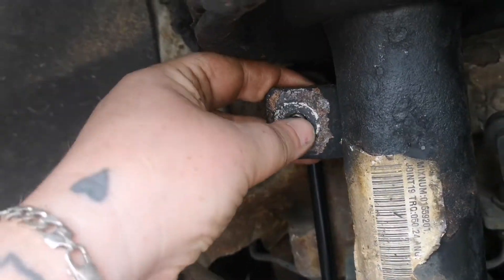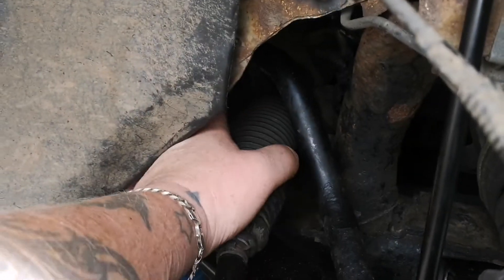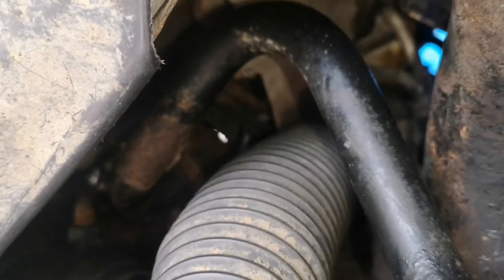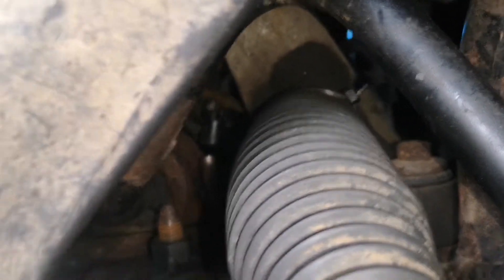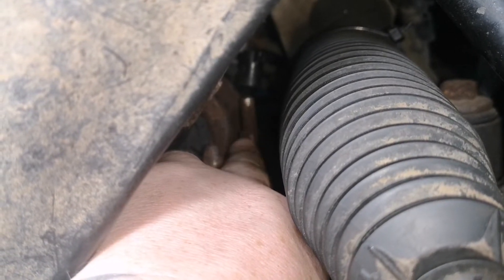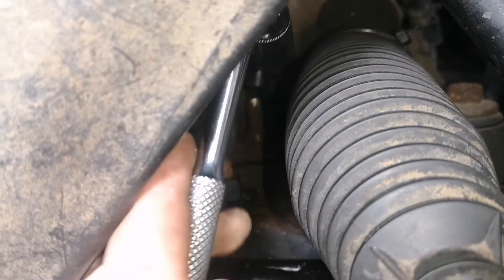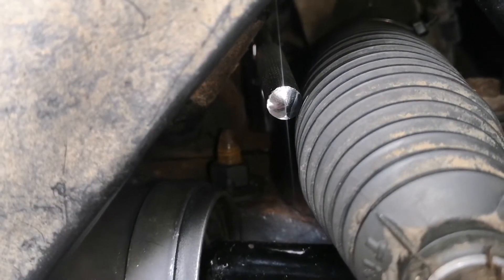I'm undoing the top bolt for the anti-roll bar link. I'm going to take that out in a second, but I just wanted to see if I could actually slacken this off. Unfortunately, there isn't a right lot of space. I've got a quarter inch 13mm socket. I think because this is the 2.4, these have got the weird nuts on — it's almost like a retaining nut with the bolt on. So that's the one I'm slightly undoing. You've got to take the cap off and we are literally just doing it like two turns at a time. I'm going to carry on doing this and then we'll get back to you.